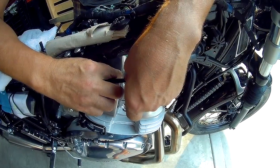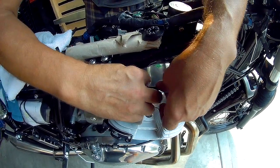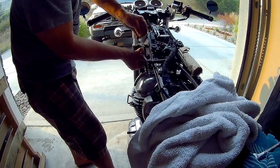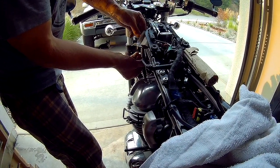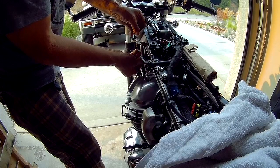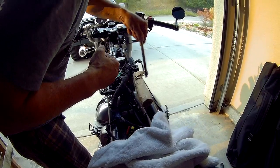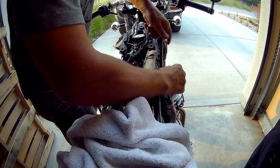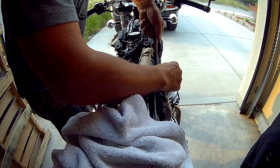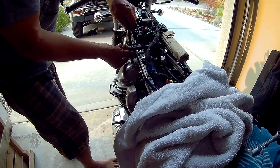Okay, when you're tightening down your valve cover, to help prevent leaks, tighten it up in a cross-hatch pattern. And I've read a couple of horror stories with people either having cross-threaded or breaking the bolts off in the head, so nobody needs that kind of grief. Just take your time and take a break now and again and breathe. It can be frustrating at times.